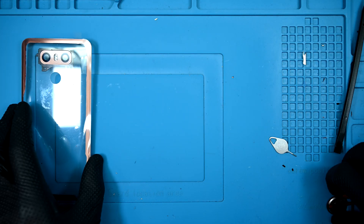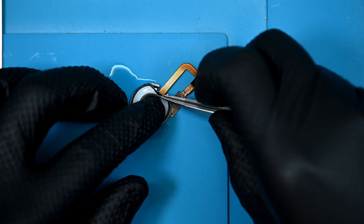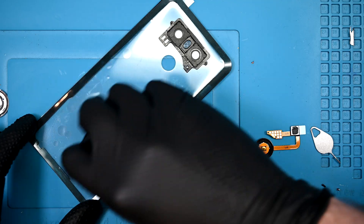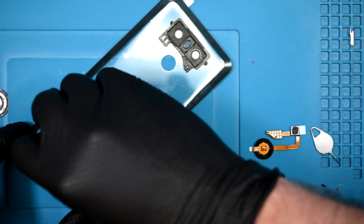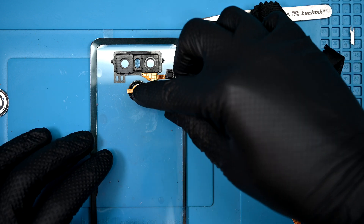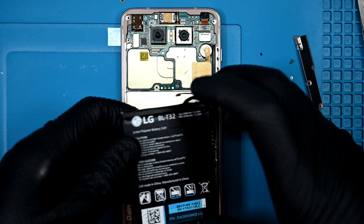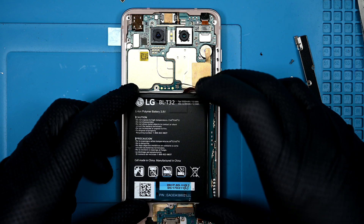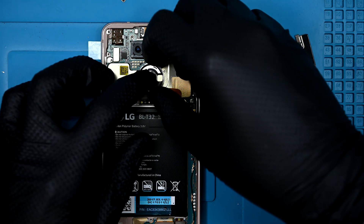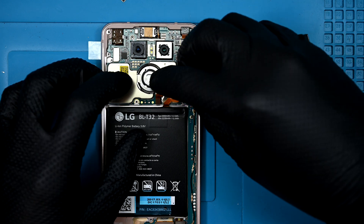Here it is — I'm pretty pleased with the result. But now it's time for the power button and fingerprint reader swap. I need to get this round metal bracket off because it provides the area where the button clicks. The white sticker around the button itself is ugly and won't be used. I'll get this back glass wiped clean of fingerprints and fine debris. While the power button won't really stay in place right now, it does need to be lined up properly. Because I can't stick the power button bracket to the glass and there isn't the antenna frame to hold it in place, I'm going to use a small bit of TESA tape to keep it centered. This will allow the button to still function without slipping around too much.